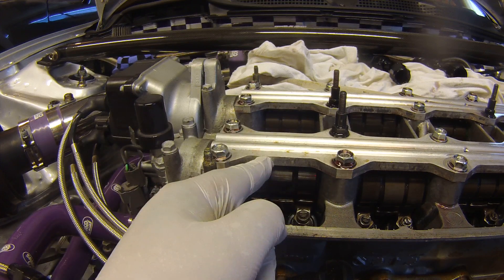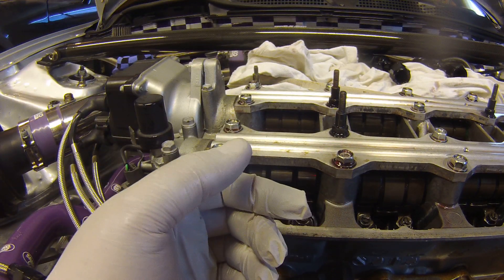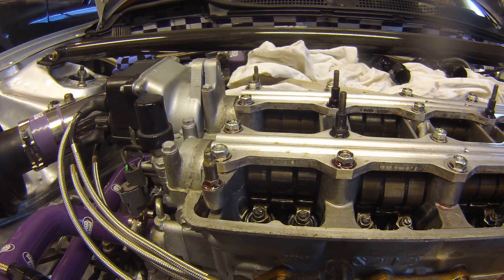The next one we'll be doing is the intake side for cylinder four. If you have any questions feel free to leave a comment. This is part of the valve adjustment on the Acura Integra B18C1 engine — fully built, all motor, high compression around 12.5 to 1. Hopefully this video helps you out.